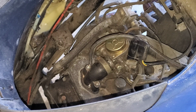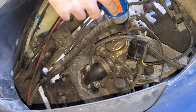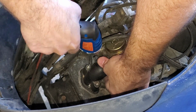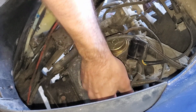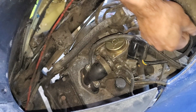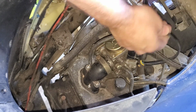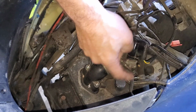That's really weird. Okay, well, let's loosen some of these clamps and undo this thing. See if we can get her out of here. Okay. Now, make sure that's still up there good. I'm just going to pop this fuel line off of here. There's that. Yeah, my butt, this was replaced a year ago. Okay. Disconnect the pre-injection. It's like an automatic choke.